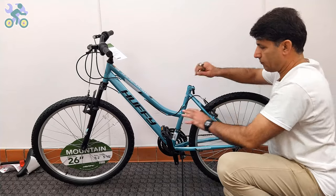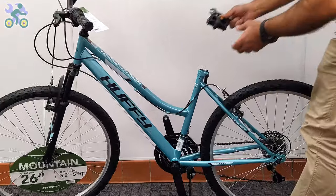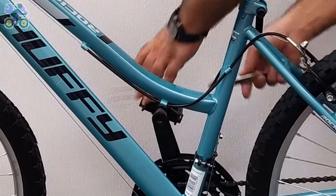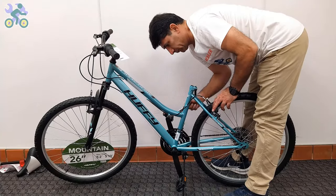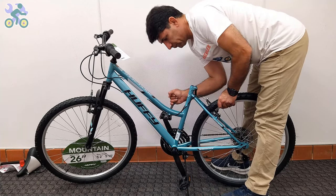For the left side pedal, turn it counter-clockwise — or the easy way: turn it toward the front of the bike. After making sure the pedal is in the correct position, turn it a few times by hand. Then, while holding the rear wheel, use a 15mm wrench to tighten it.